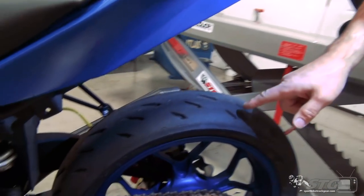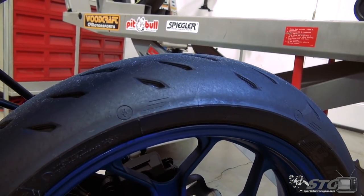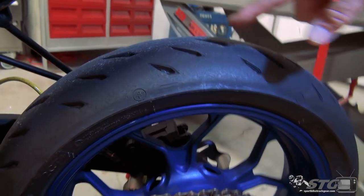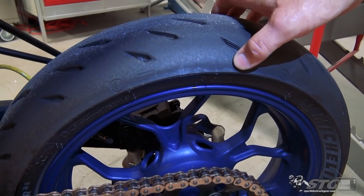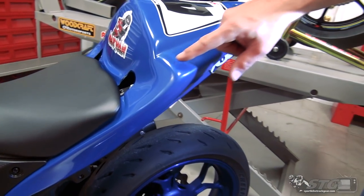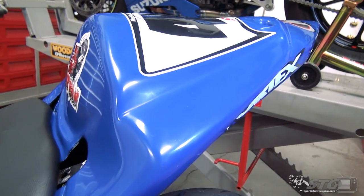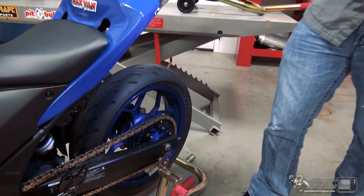Tires - Max's bike is a great one to look at for this. Think 50% or more and in good condition. These Power RS's are going to pass that, no doubt about it. The kid's still got little chicken strips here, we'll work on that next time. Also, they don't want to see the tire discolored or blue like this from overheating. They want to see it in good condition - 50% and in good condition.